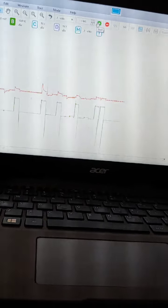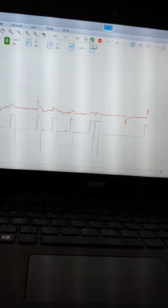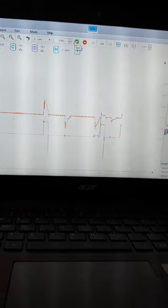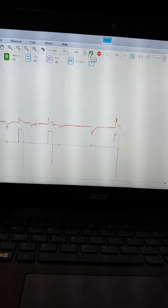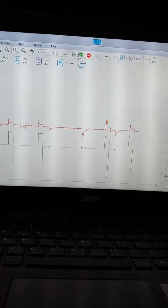As you can see on our amperage pattern, if I lock it, and then our voltage pattern, it's present, still there. That's around 12 volts, which is good. We're not losing voltage, but on our motor side, that's our problem. You can see that we can definitely diagnose if we have a problem with our actuator or our voltage supply, because our voltage is there, no problem.